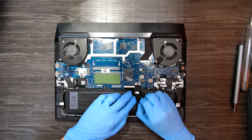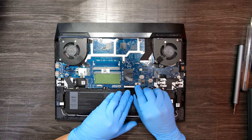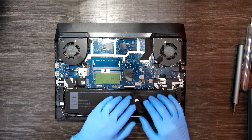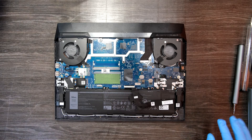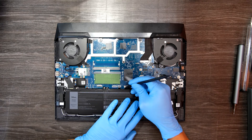You can unplug the battery connector right here. If you want to change the battery, you can disconnect the battery cable and you can remove about 1, 2, 3, 4 or 5 screws around the battery. Then the battery can be removed easily without any kind of effort.